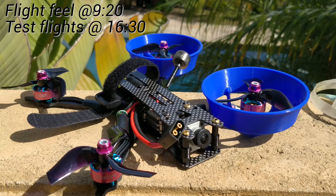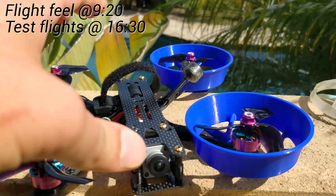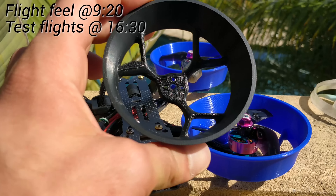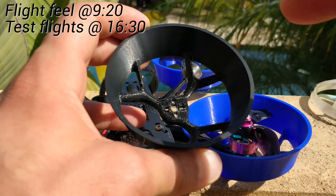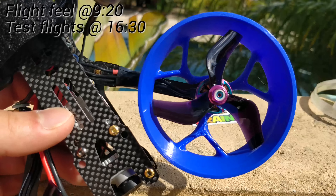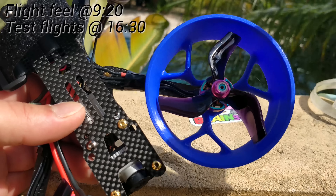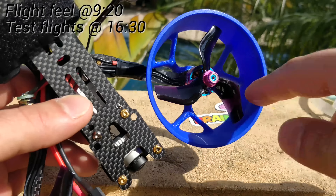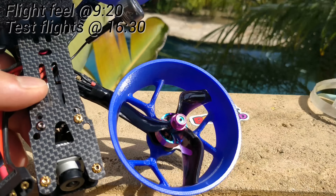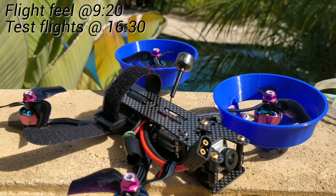You can see there is kind of a space around the edge here, and that may or may not be a small enough gap to have the appropriate effect. I can tell you that this quad is extremely loud, so I'm going to guess it doesn't do enough to separate the top from the bottom, resulting in efficiency loss. This quad is not terribly inefficient, but it's not getting the maximum effect of the duct system. Now Stan FPV's duct design does something very specific: it's designed for a three inch propeller, and the bottom ring is smaller than three inches. He provides pads to put under the motor to lift it so the prop is just barely off the rim — you can see the prop would not fit if the motor sat any lower. This gives the improved effect of separating top from bottom.